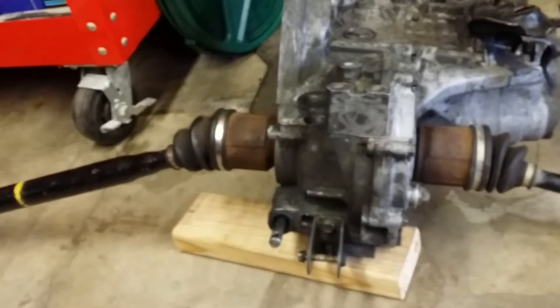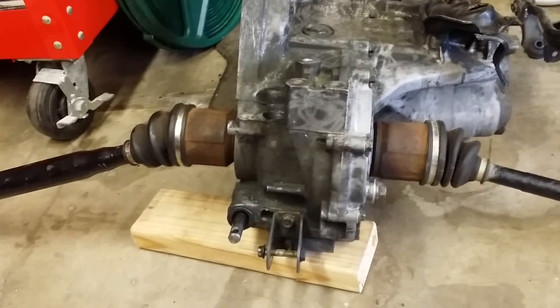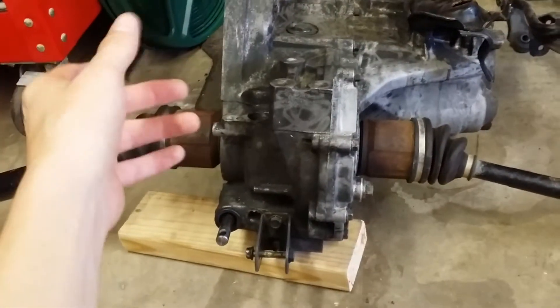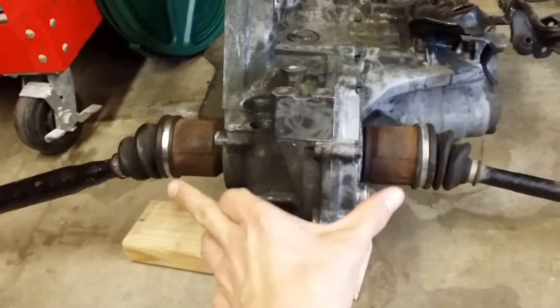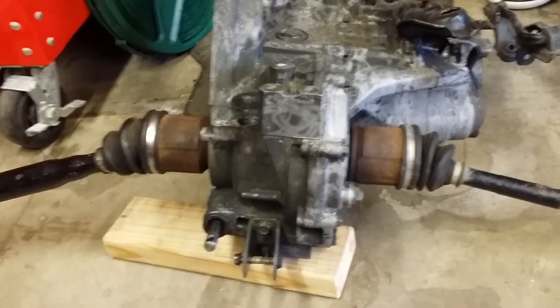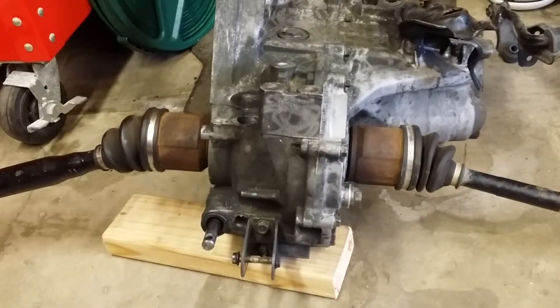Actually I'm probably in fifth. But I've done it in all of them — I put my foot on this one, held this one with an arm, and neither one of these will turn, but the input shaft will turn with very little resistance. That doesn't sound to me like the way a transmission should work if it's functioning properly.